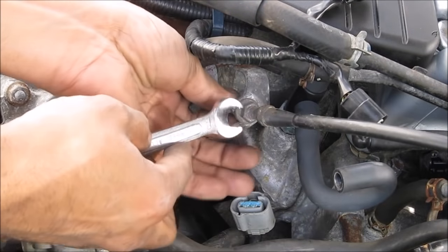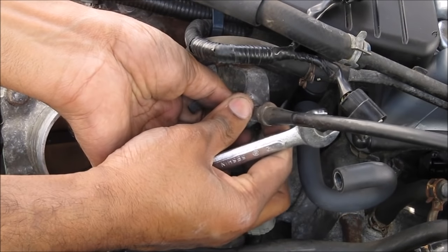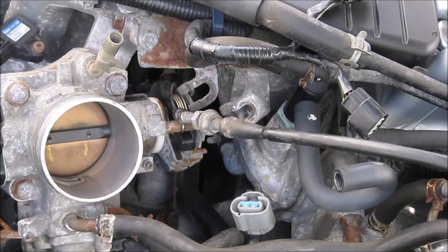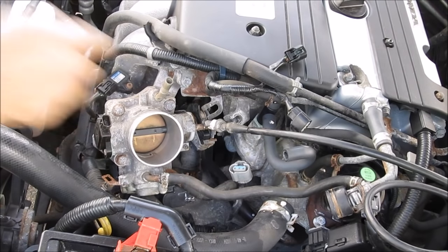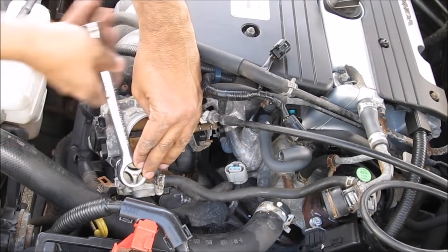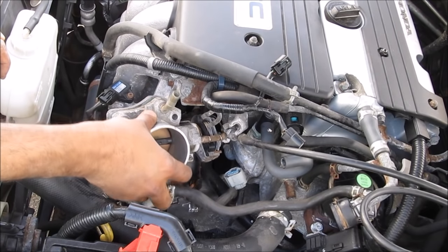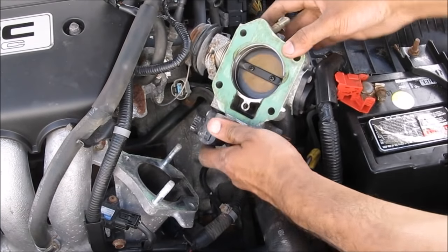This part's optional: you can use a 12mm wrench to loosen the throttle cable nut, being careful not to play with the adjustment, and then remove it from the bracket. There are four 12mm nuts and bolts that hold the throttle body on that I'm going to remove next. Bolts are always harder to free than nuts. With everything free except for the coolant lines, I can then remove the throttle body.